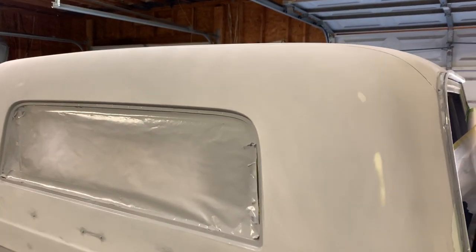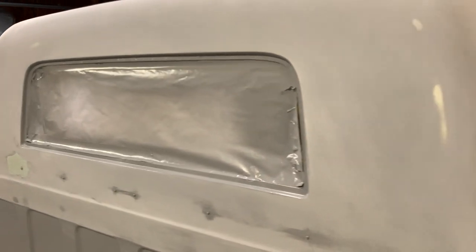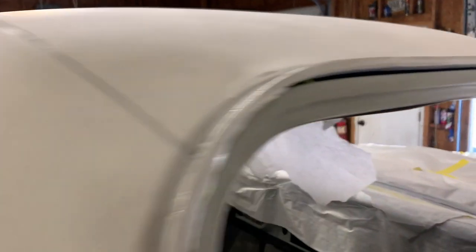Since it's tough to cut, I've cut all this — all this is in 120 grit. 180 doesn't seem to cut enough, so I go with 120. Now since I've still got a lot of primer on this and it doesn't look like I broke through in very many spots at all, we're going to guide coat it, block it down to 180, and then prime it with a high-build urethane primer — something that's easier to sand for our final sanding before painting.